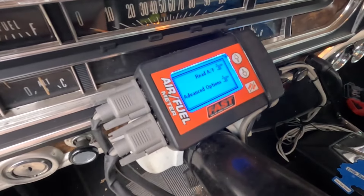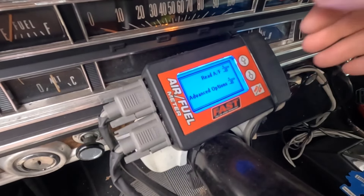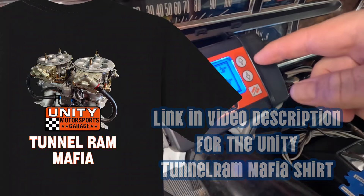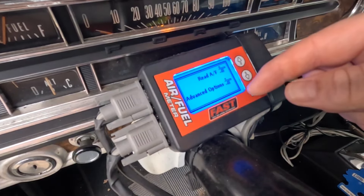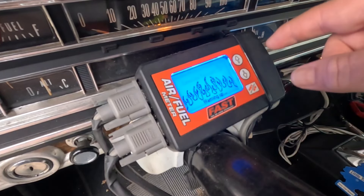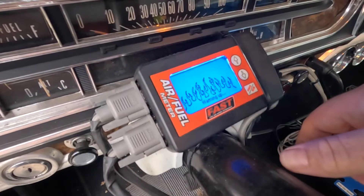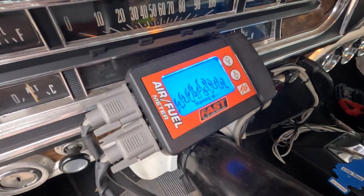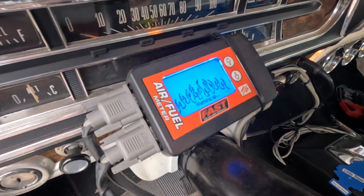I think this is going to be a pretty awesome A/B test. The reason why I'm not putting these carburetors on today is I'm waiting on new oxygen sensors for my wideband O2. This is my ultimate secret to success — actually having a wideband dual channel for the tunnel ram setup. What this does is it allows me to find out in real time between the driver's side bank and passenger side bank. The problem is the oxygen sensors are dead — they started acting kind of funny a while back, getting slow and then giving me crazy readings. I guess that's to be expected after they're nearly five years old.